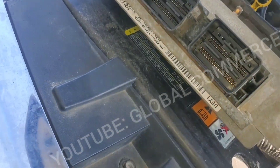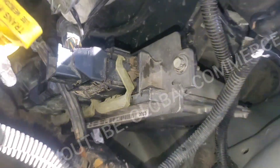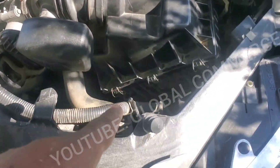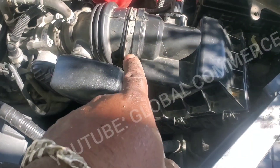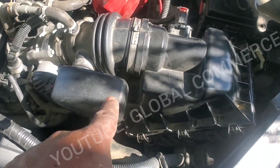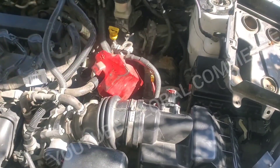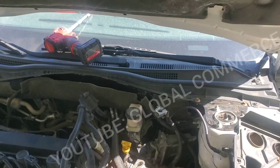At the car now — we pulled out the whole unit and installed our replacement that we programmed on the bench. Now we're going to connect up and program the transmission code, which is on a sticker right here under the air cleaner box, do a parameter reset, and that's it. Should crank right up.